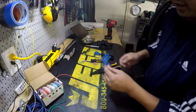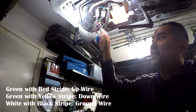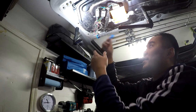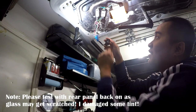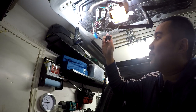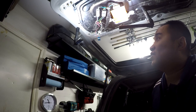I'm going to get the heat gun in to heat up the connectors. All the wires are hooked up: the ground, the down wire which was green with yellow, and the up wire which was green with red. I've plugged in the switch so it's now removable, which is why I mentioned earlier you should take the harness with you when buying the switch — so you can remove it if you ever need to take off the panel. Now let's test it. You can't just press it quickly; you actually have to hold it for one to two seconds — it's probably designed that way so someone can't accidentally roll the window down. And it works — it's already all the way down.